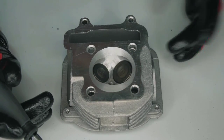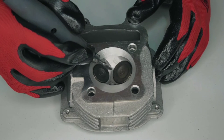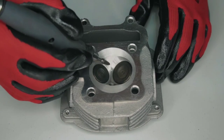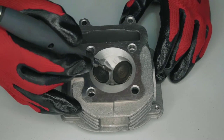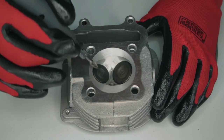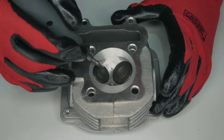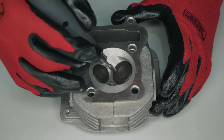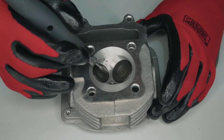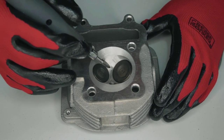The piston head is 63 millimeters. The reason why I'm removing these sharp edges is because they usually increase the temperature on the engine — they're really thin and they get pretty hot, making the engine run hotter. I'm going to leave the valves in place right now because I'm not going to be using them, and that's also going to help me protect the valve seats. If anything jumps, it'll damage the valve and not the valve seats. If you're planning to use the same valves, be very careful — I'd recommend using high performance valves.